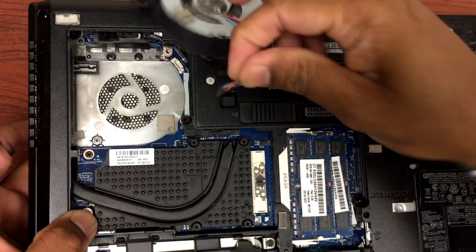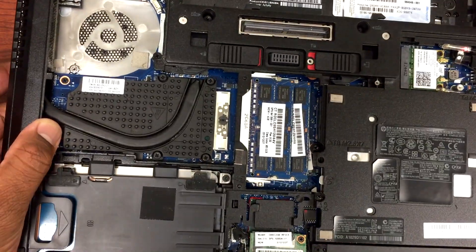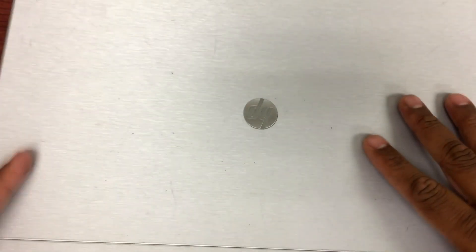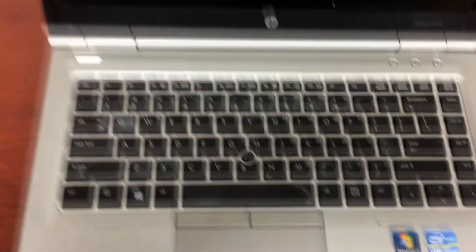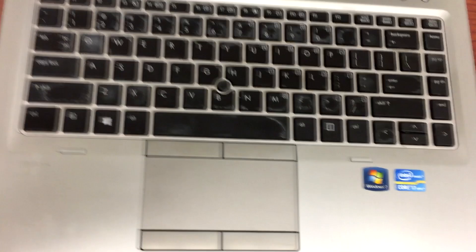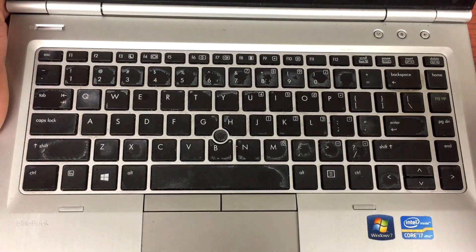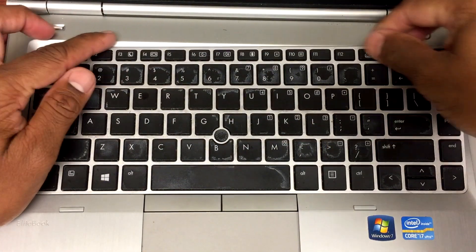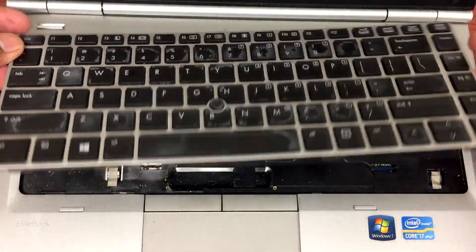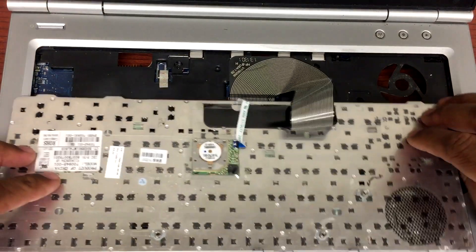Let's leave it on the side for now. Now we're gonna flip this forward, open the front lid, and on one side of the edge of the keyboard, I have this small screwdriver that I'm gonna slide in a little bit and lift it up. Gently lift it from each side — it's pretty easy to come off once all the screws are off from the back.